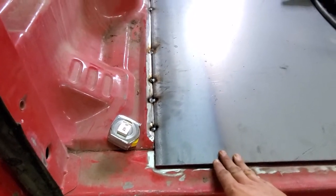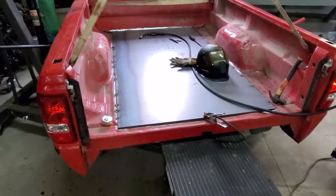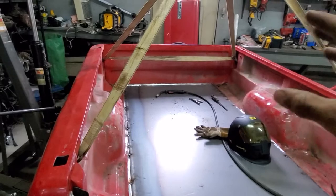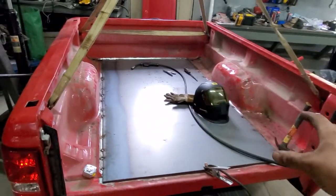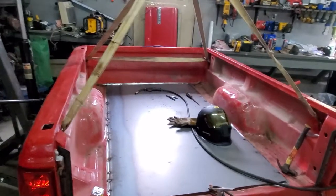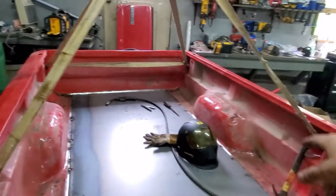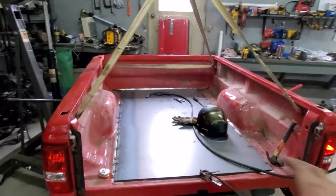Then I can flip it back over, finish welding all the seams and the front. Because of the way beds are, there's basically a roll — I'm going to try to heat this seam up to roughly where it needs to go, beat it down with a mallet, then weld the bottom seam and put the holes in for the bed bolts. When welding, it's important to only do little sections at a time so you don't warp it. It is getting a bed liner paint which will cover imperfections, but less warping is better. Go slow, spread the heat evenly — do a couple here, then a far corner, then up here — basically an X pattern so you're always heating away from one general location.